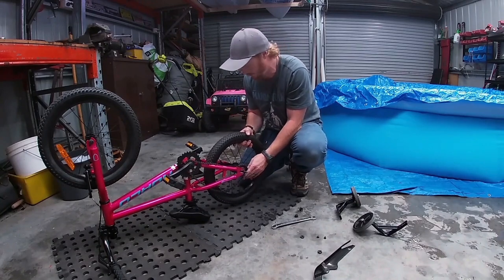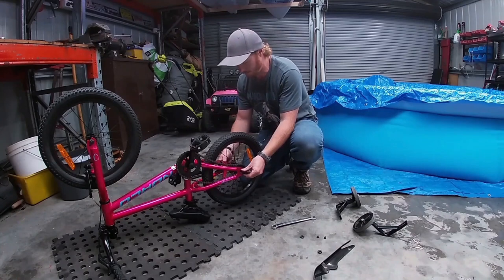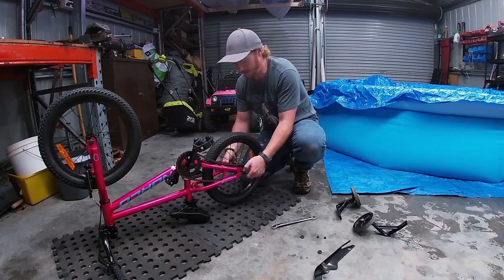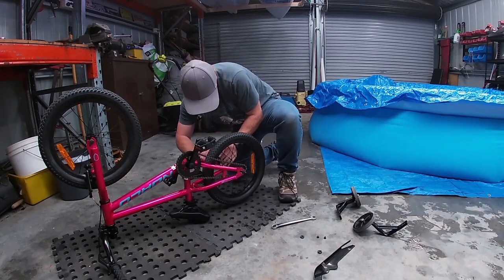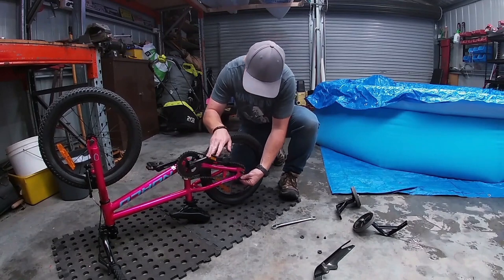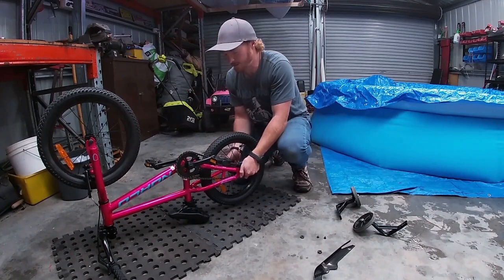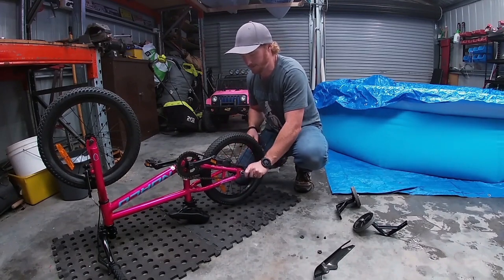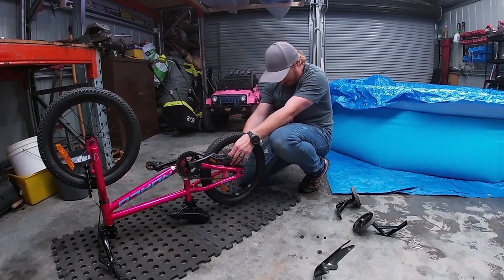Slide it in and put it up on the frame. I'll use the nuts that held the training wheels on to hold the wheel on, because they're a bit wider and won't have so much thread hanging out the end. We'll get on with the spanner better. Start this little bracket here at the hub so it's not popping out too far. Make sure that chain's on all the way, otherwise we'll have a problem. Make sure the wheel is square in the frame — chain side up first — and make sure the chain's not running tight. Square it up in the frame and get it tightened up.